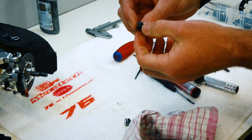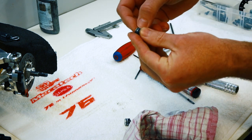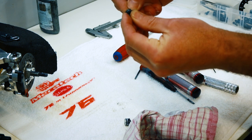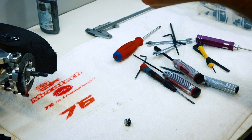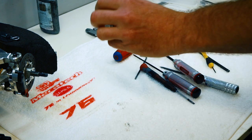That'll help. But that build up of gunk there is exactly what gives you some creep over time. As you can see there, I have to scrape it off with my nail. With a bit of thermal expansion with these guys, over 10 minutes in a race, 20 minutes in a race, they'll soon bind up and cause you some trouble. Well worth doing.